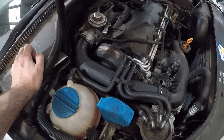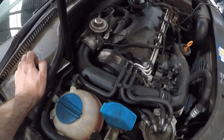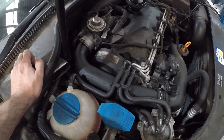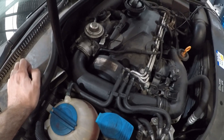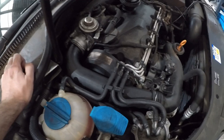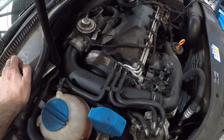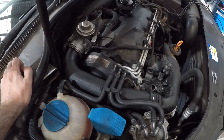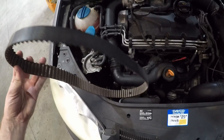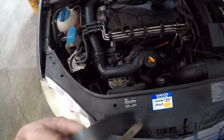My mechanic put the new timing belt kit on. He showed me that the tensioner was also not set up properly - so other than the crank being out one tooth, the tensioner not being set up properly contributed to the slack and probably made it a little bit worse. We put the new belt in, set the tensioner up. Because of all the white marks over everything, I think the person who originally fitted this belt didn't have the proper special timing tools - you can still clearly see all the markings on it.